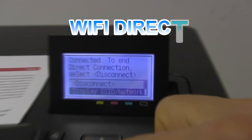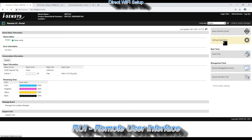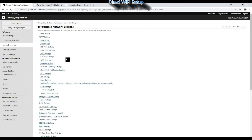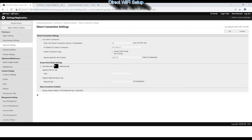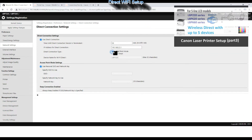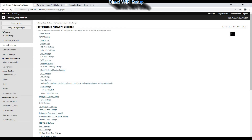In the last part I will set up the printer to print using direct Wi-Fi. I will set up using the remote user interface. Follow the steps to set up direct Wi-Fi. It is disabled by default but can be enabled, same as on other LBP printers. You can follow the video in the upper right corner of the screen for the smaller LBP model. Similarly, memory media print is supported but disabled for security reasons.